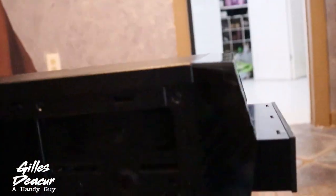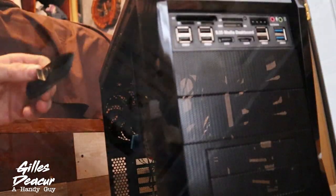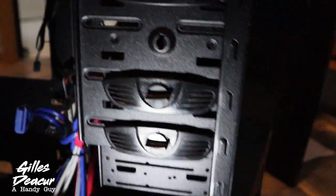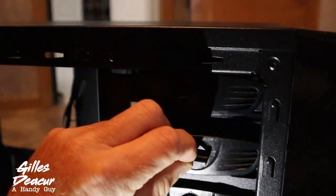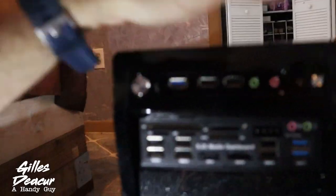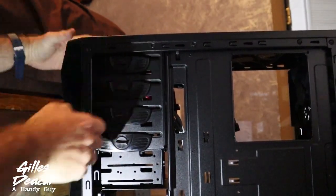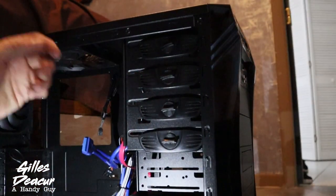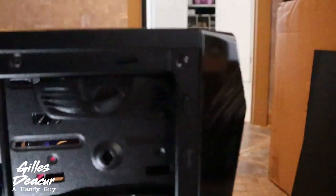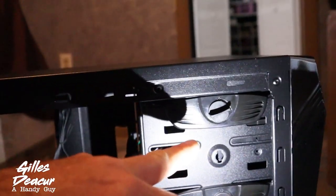I'm not sure exactly why this is not fitting into my hard drive bay — I imagine it has something to do with this. So let me take off the other side of this case — panel aside. Now it slides all the way in. It looks like this mounting hole is flush with the screw hole, so I can either mount this box with a couple screws or with the bracket that comes with this. I'm going to put this on here — it's hard to do with one hand — and that's locked. Let's lock the other side. My box is in there actually pretty good. However, if I'm pulling and pushing on connectors it might need extra support, so I'm going to throw a screw in the top on each side and then put that panel back.